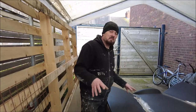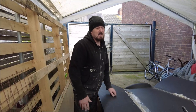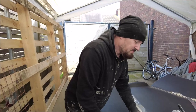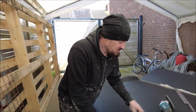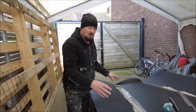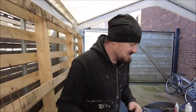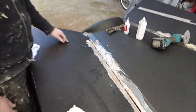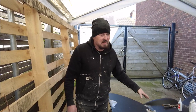Another point — if this car had been done in steel, the rust and rotting would have lifted this by now, as the car sat outside for like six or seven years, and I would have to remove all of this. But because it's aluminium, the wood has rotted away behind it but it doesn't really matter. The aluminium has no rust ingredient that's going to carry on the decay. I've put the aluminium tags on just here and they are now holding this with a lot less spring to it. So what I'm going to do now is really rough this up with the grinder to make sure I get a really good bond with the fibreglass, because that literally holds the panel together.